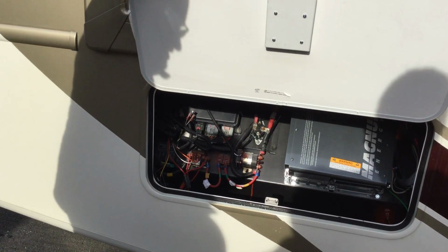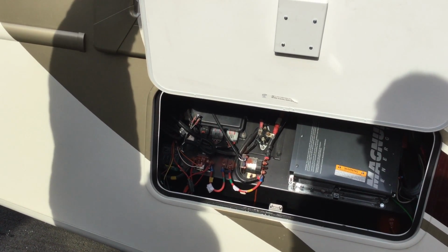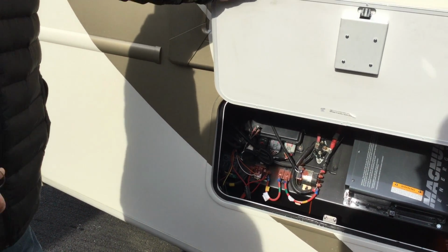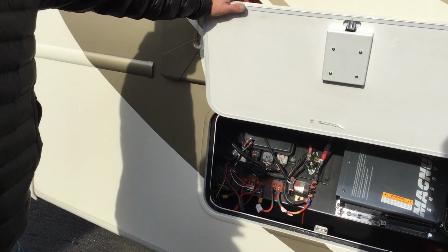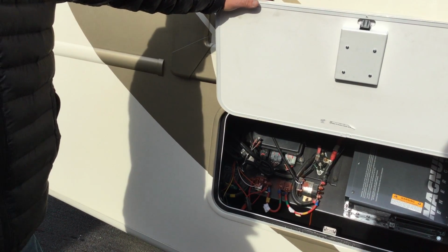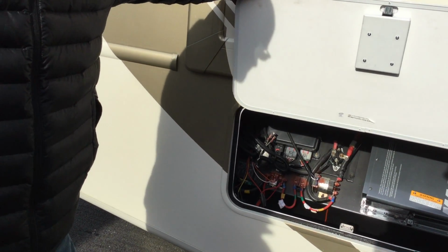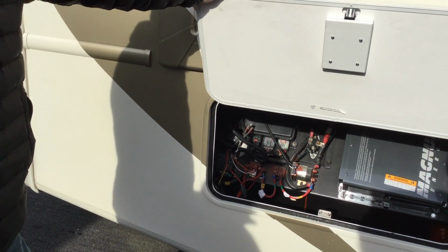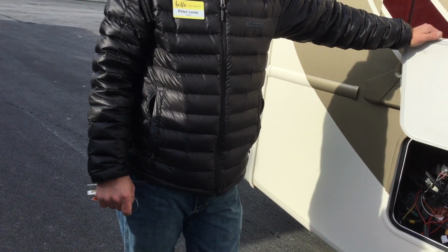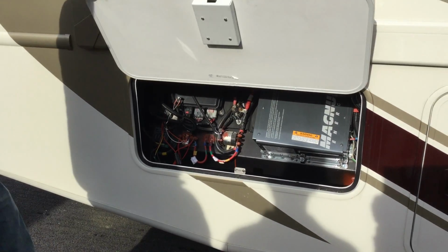Our car is maintained every 3,000 miles. How often are they doing this? Honestly, I'd have to read the manual on it because every motorhome's different. It's not a standard. It's all on the size of the diesel engine. I think this one's a 300 horsepower, so I want to say it's 6,000. Don't take my word on it. I'm used to the 350, 400 horsepower diesels, and those are a little bit longer for the servicing. I think they're like 8. This should be at 300.